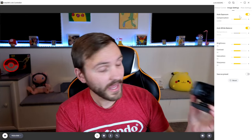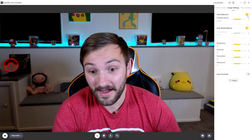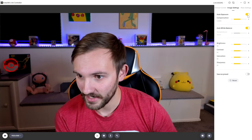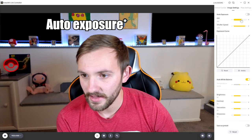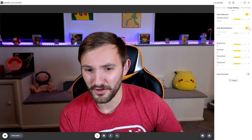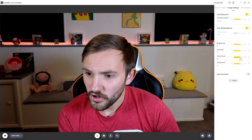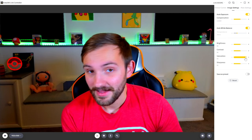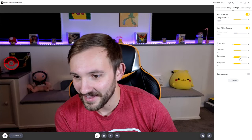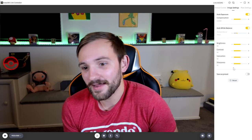I made a whole video for the Elgato cam link talking about how to change settings to make them look really good. For this webcam, it looks great out of the box. I tried to make it better by changing settings, but there was really nothing I could do that made it look any better. You can turn off the exposure and brighten up with higher ISO and lower shutter speed if you want. You also have auto white balance, which computers are really good at figuring out. You can turn up the saturation a little bit, but no matter how much I played around, whenever I reset it, the default picture always looked better than whatever I made.